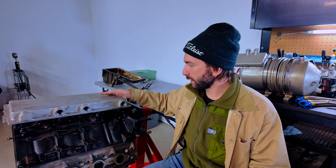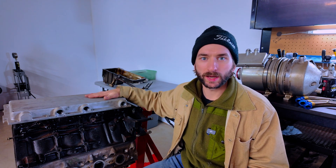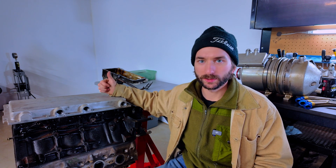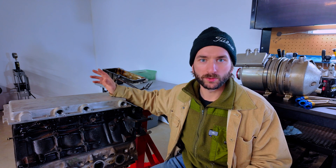Once the engine is supplied with oil, the oil drains back to the oil pan — but in this case, we're not using a sump pickup anymore. This oil pan is off a Craftsman series pickup truck that uses the LS platform, and as you can see, it is flat across the bottom — there's no big sump in the back, as you see on a conventional oil pan. Most parts coming off a NASCAR application are designed to be extremely robust, have well-understood and long life cycles, be readily serviceable, and overall be fit for the job of motorsports competition.